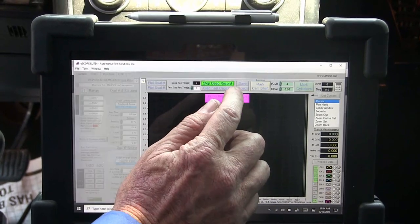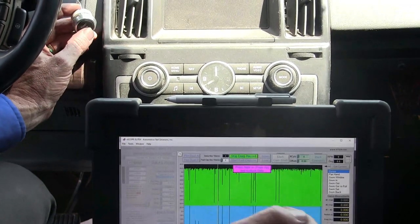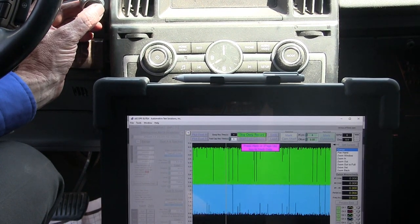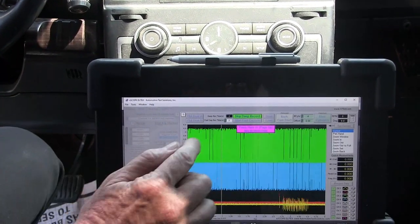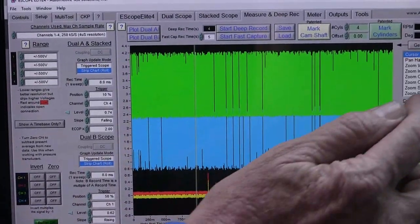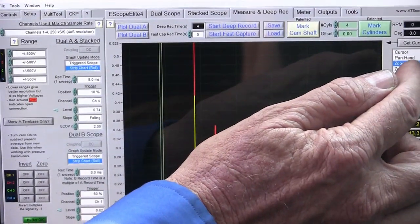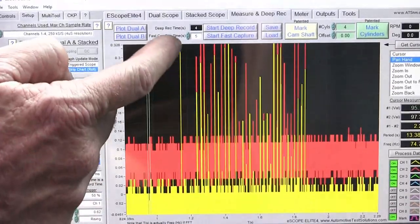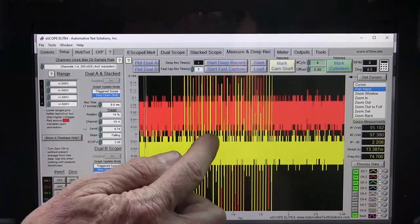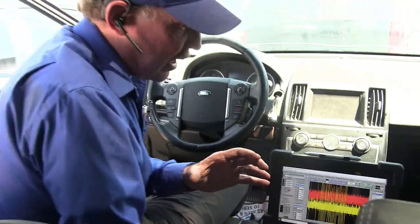What we're going to do is get a recording and push this button. Right here you can see where something happened when I activated that. What this tells me is that we're not totally grounded — do you see these spikes coming out of there? The bus can have something happening, so it's not totally grounded.